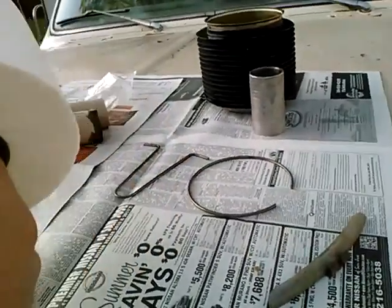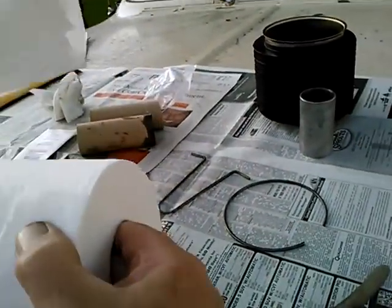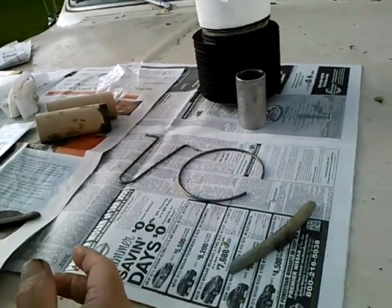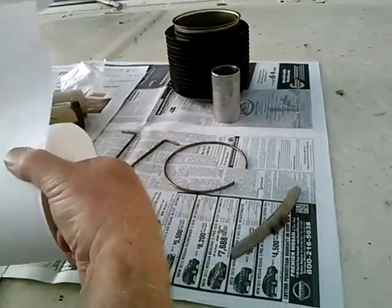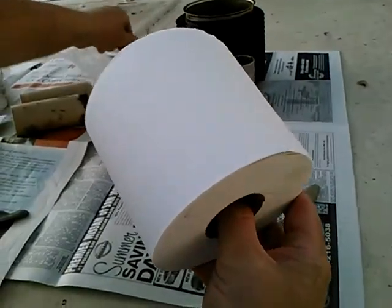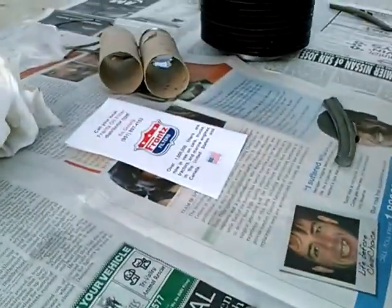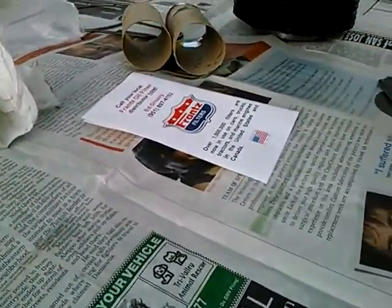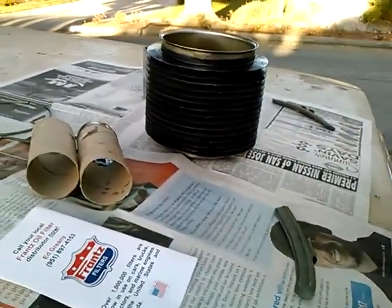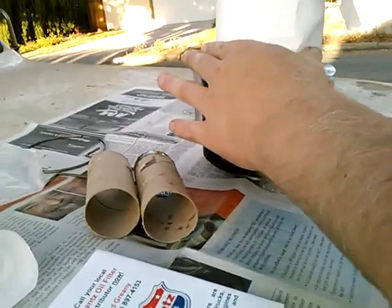So now the challenge is to figure out how much of this to peel off. The oil pressure can push it down against the screen — that's what I'm trying to achieve here. In the past, as you can see in some of my earlier videos, I packed this in extremely tight, thinking that would create better filtration. But it might be that that increased the flow that's not going through the paper but is following the cardboard tube and missing the paper.